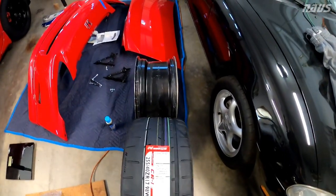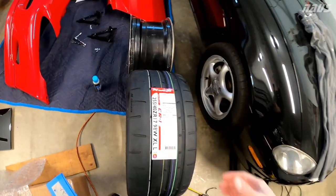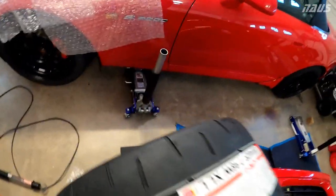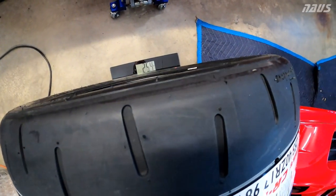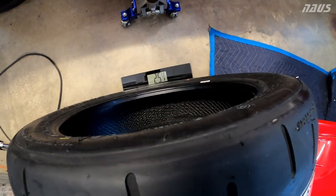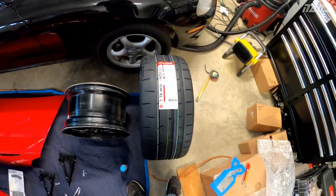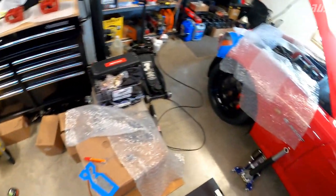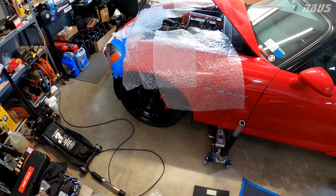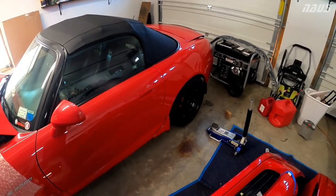They'll be a little bit too big for my 9-inch wheel. Let's get a weight on them — setting the 255-40-17 on this scale, as you can see it's 25.4 pounds. I'm thinking of dropping down to the 245-40-17 for this car, because I think they will be as wide if not wider than the 255 Bridgestone RE71Rs I already have on the car.